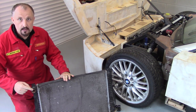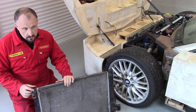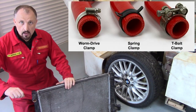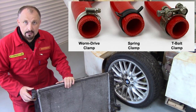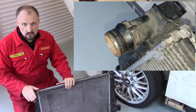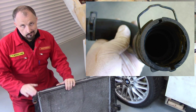These are where the hoses go. On the 2.7T, it doesn't use Jubilee clips or hose clamps with a screw that can be tightened and loosened. This is a clip-style hose — the hose goes on and then you put a clip in. That's not very good if you're trying to do a DIY build. This is a factory thing, so that's going to be an issue.